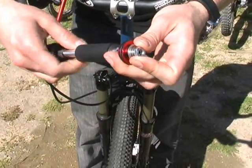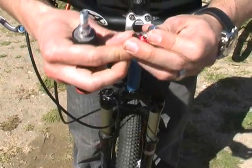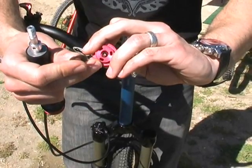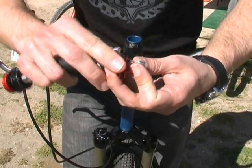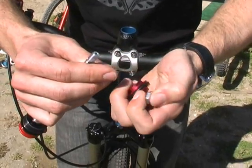The high-speed damper is a lot like a TPC damper — it's shim-based. This is the shim stack here, and these are the ports through which the oil passes. So unless the speed needle is totally closed, you've always got oil moving through the low-speed damper, but the high-speed damper is engaged on any sort of high-force, high-speed impact.